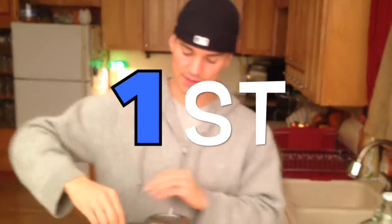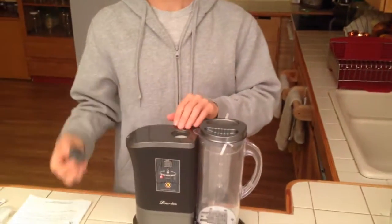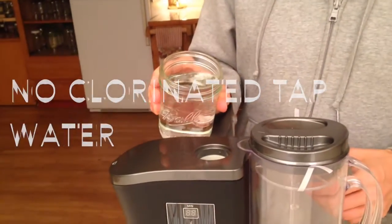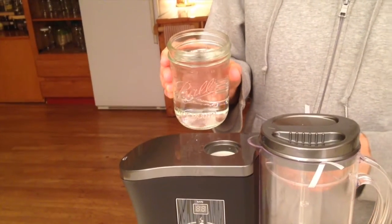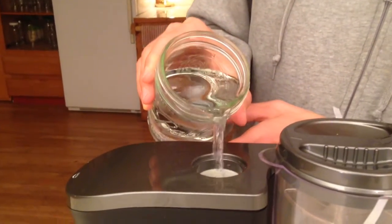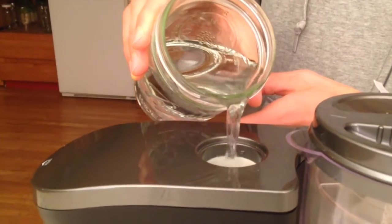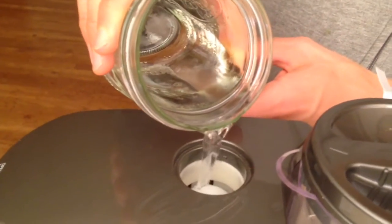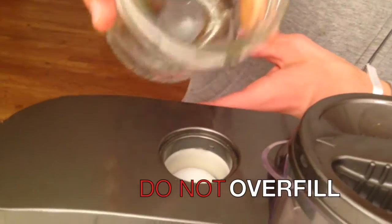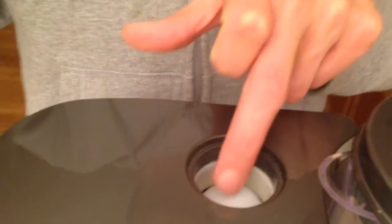The first thing we want to do is put water in the tank. Here we've got about 400 ml of filtered water — you do not want to put chlorine in this machine, so make sure to use some type of filtered tap water. So we start pouring; at first you can go at a higher speed, but then you want to slow down because you keep watching the ball. The moment you see it start floating — see now it's floating, see how it's buoyant?